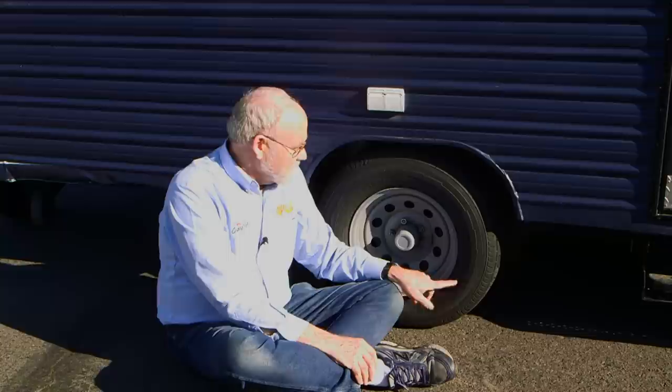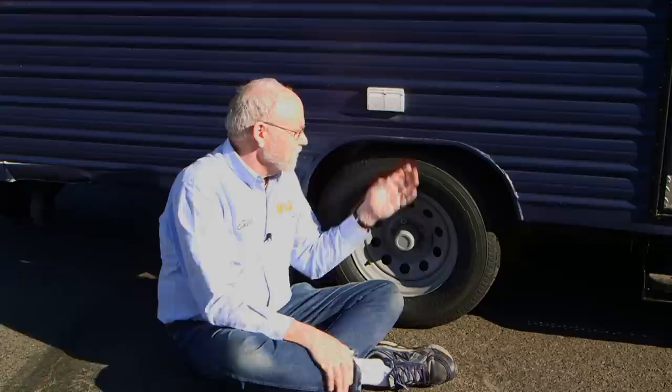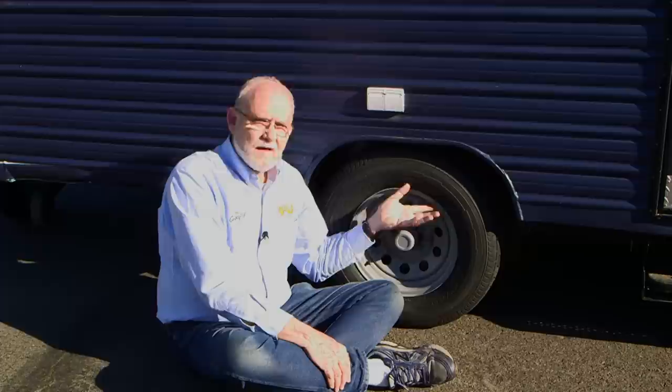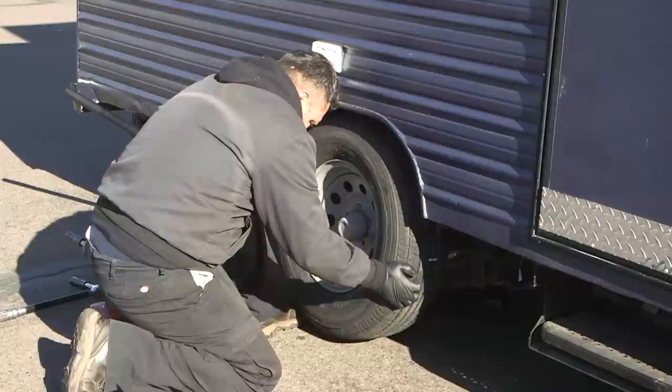The new Endurance tires look great on the trailer. When we selected the size, we bumped up one size from ST205-75R14 up to ST215-75R14. The 215 tires are a little bit larger diameter, a little bit wider, but they fit the opening just fine, fit the wheels, and don't contact the wheel well — there's plenty of clearance. The advantage to jumping up one size is that the new tires have approximately 200 pounds of extra payload capacity per tire, or in other words, another 400 pounds of weight carrying capacity for the entire trailer on the axle. This doesn't change the gross axle weight rating on the trailer; it just means we have a little room to spare as far as loading things into the trailer, and there's less chance we're going to be overloading the tire.